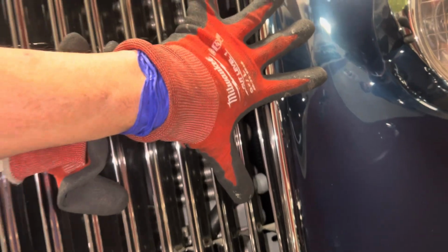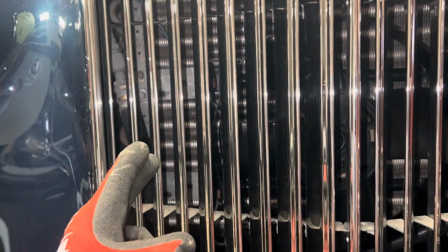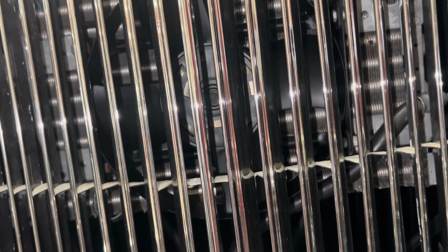We have the 3/8 inch tubes, and it's not a very big condenser. Let's see, this is 9 inches, that's my size right there, 9 inches. And then we have another 3 inches down here. So we don't have a very tall condenser, and we don't have a very long condenser. We have a low fin density, low surface area condenser design.